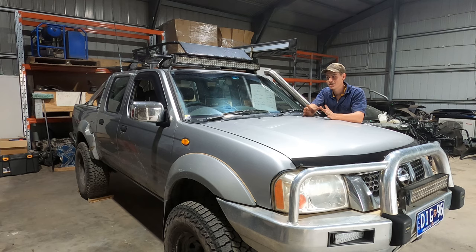If I'm up at the beach in the sand, where you're under load with a lot of boost building and a lot of restriction on the wheels — say 3000 RPM with all your boost — the sand is physically dragging your tires to slow it down as quickly as it can. So you come off the accelerator, your revs drop really quickly, but you've got all that boost built up. It can't go through the engine and you don't have a blow-off valve.